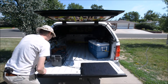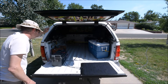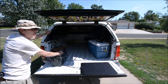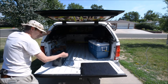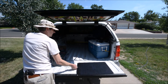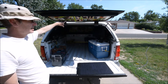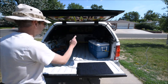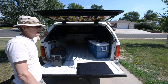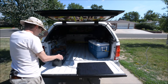We're still at 11.2 volts. Now we got the red light — it's charging. And the battery went up to 14.3 volts already, instantly. So this little booger does put out. We're just testing it on this tailgate. I got 240 watt panels on the top of the truck — batteries, an inverter, charger controller, super battery booster, and a power guard plus battery switch. So it's already charging this sucker up.